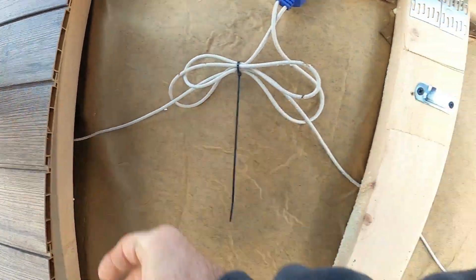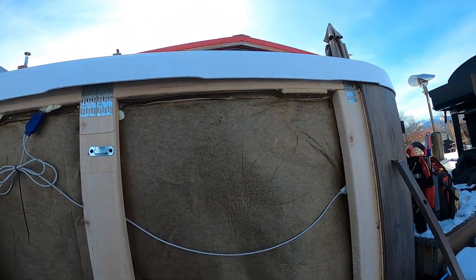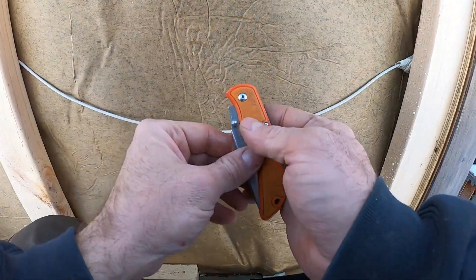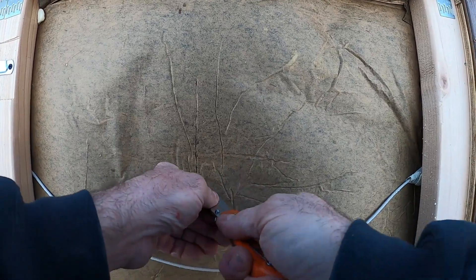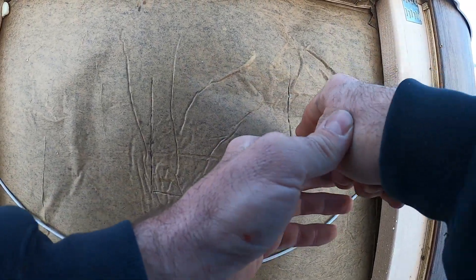Now we've got our panel off. As you can see, these hot tubs are completely foamed in to the actual outside panel, so there's no easy way in. We're going to have to cut our way in and find exactly where that light is. I'll find the actual light, come down to about the depth of it, so we know the light's in this area. We're going to cut a decent size hole into the foam here - not going too deep because sometimes there are wires and hoses just behind the foam. I like doing square trap doors.